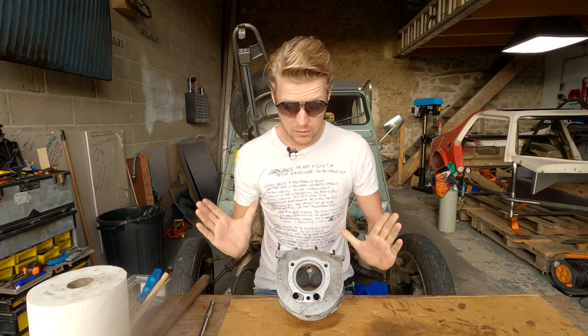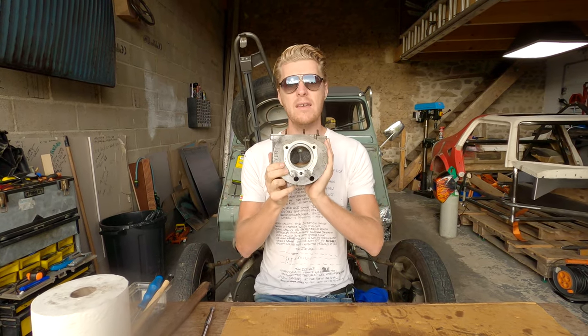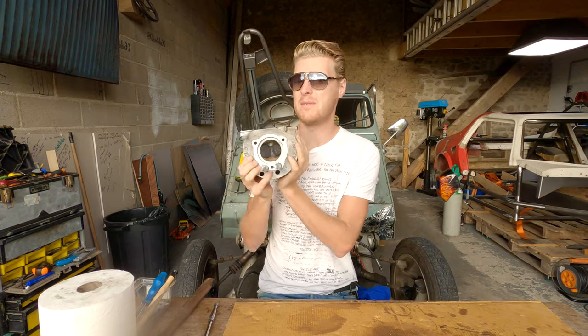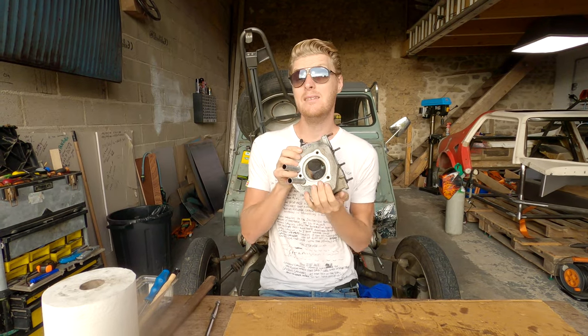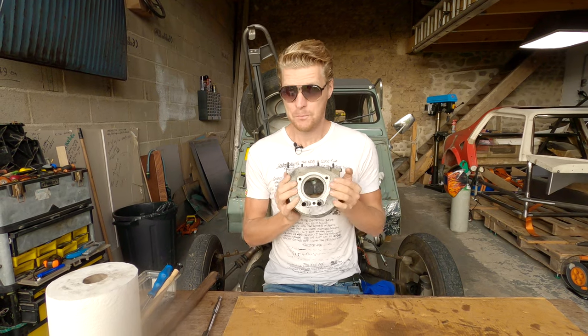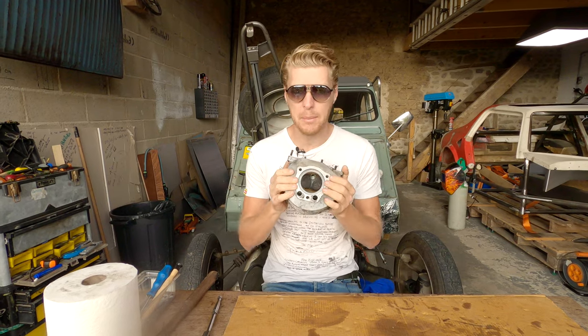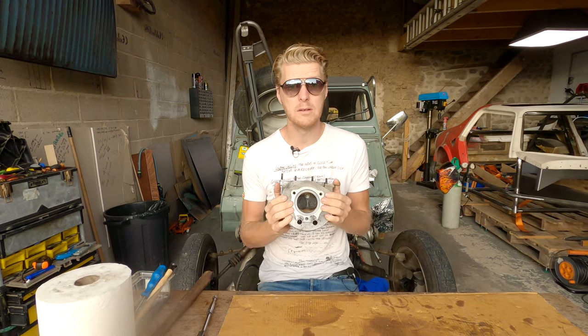In today's video, we're going to be sorting out Jolene's heads. Now this is a 425 18 horsepower 2CV engine. They made these from 1963 until 1970. And previously, Jolene had a voltage issue. With the voltage issue, of course, comes a really bad spark, and a bad spark creates carbon buildup.